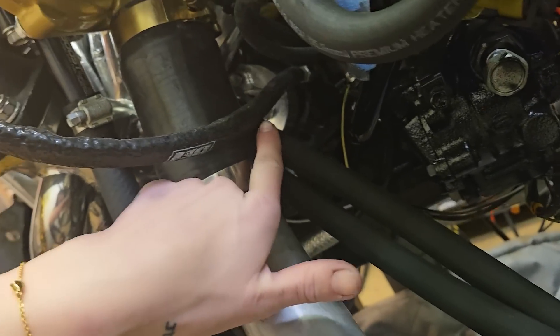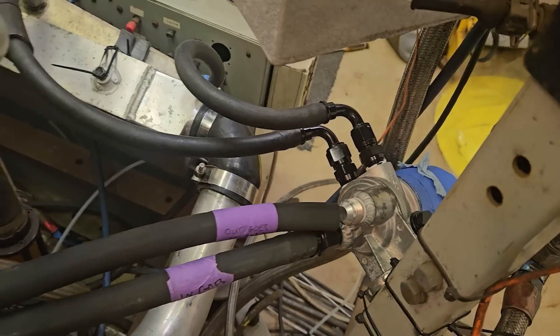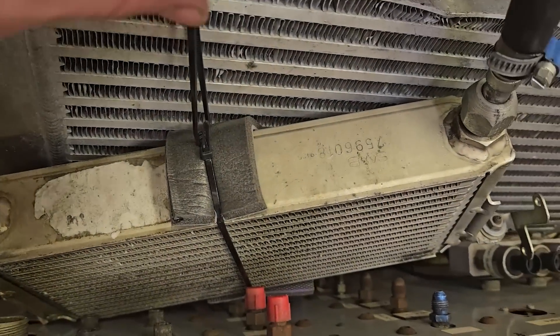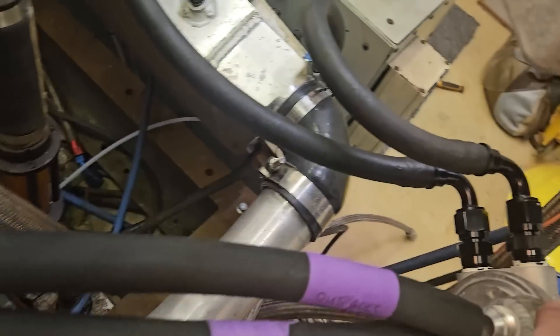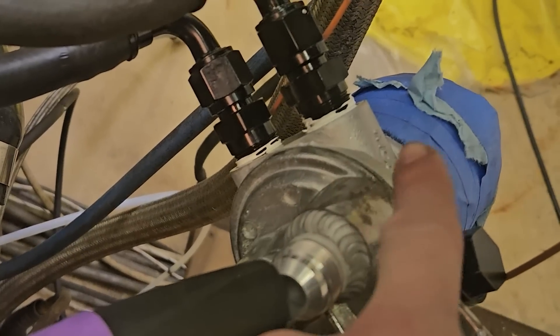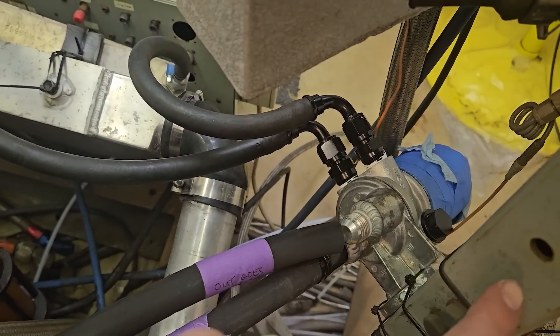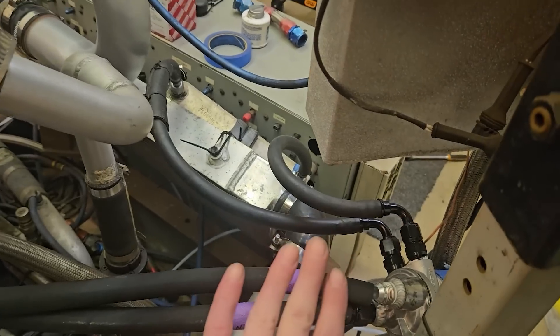I've got this Drift Motion beautiful billet remote oil filter — I wish you could see it when it's in the car — and that's a Toyota factory oil filter. I've got three of them for the break-in, even though my rings are already broken in, but my camshafts aren't. Then it's going to my oil cooler. This is from a Saab 9000, which is a performance Saab, and it's been awesome for me. And this is the Drift Motion MoCal thermostatic oil sandwich plate — it's a 90/10 setup where it always has a little bit of flow, so when it finally reaches 180 degrees, it's not just going to dump a bunch of cold oil in there.